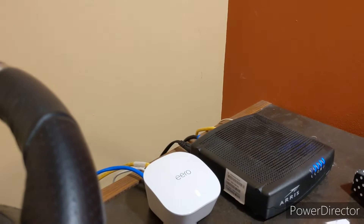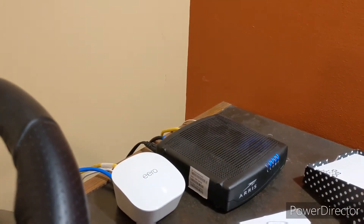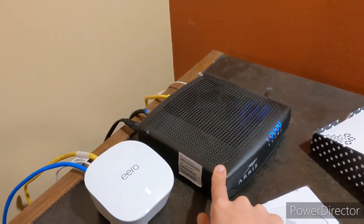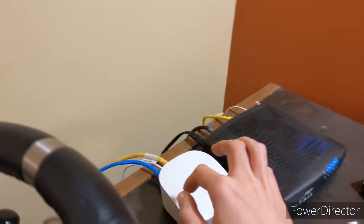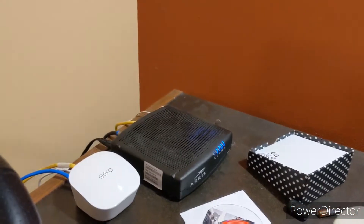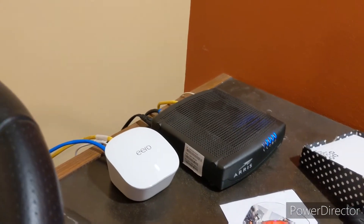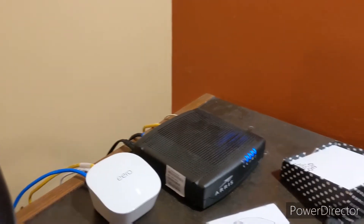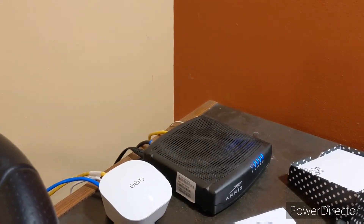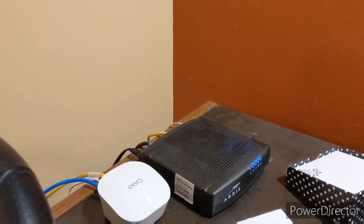We just set up this one and I'm checking it's connected to the internet right now. The setup is pretty simple — I just unplugged the existing Netgear Nighthawk router, and this is functioning as a wifi router. You turn the modem off, unplug it from power, connect the two network cables. The blue one goes to our PC, the yellow one goes to the modem. Then you download an app on the Google Play Store or Apple App Store, open it, and it registers your Eero with Amazon's servers. You can name the network whatever you want and change the password.